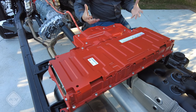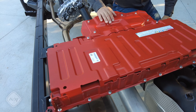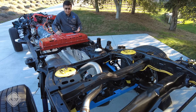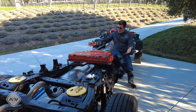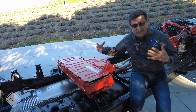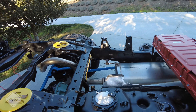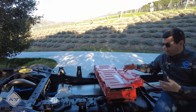A lot of folks have asked why Toyota continues to use nickel metal hydride packs rather than more modern lithium-ion packs. Well, there are a number of reasons. Nickel metal hydride packs actually have better cold weather performance than lithium-ion packs, and even though they are less energy dense, it's not that big of a deal — this pack is actually pretty similar physically to the pack in the F-150 hybrid, which is a liquid-cooled lithium-ion pack. This one is air-cooled; it sucks air from the cabin through the battery pack and exhausts it out to keep the battery cool.